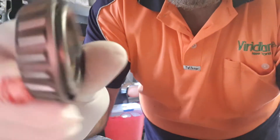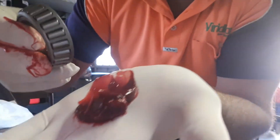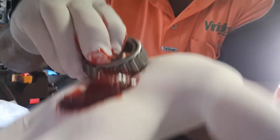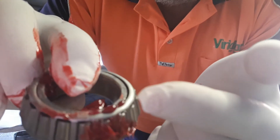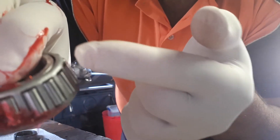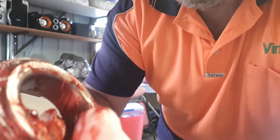Let's demonstrate. Bearing large side, place in the grease, take small bites until the grease comes out the back. Look there — you can see the grease coming out the back. Keep spinning the bearing and feeding the grease through it until it's completely packed through the back right here.